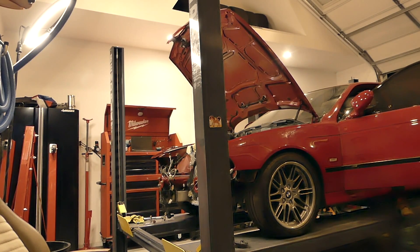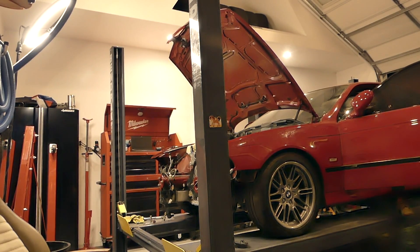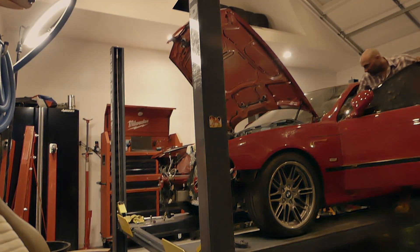Run the engine for 15 minutes, varying your RPM between roughly idle and 5,000 RPM. After 15 minutes, stop the engine and change the oil. Step 5: Change the oil once again using mineral oil, break-in oil. Then drive the car normally for 100 to 200 miles approximately, and then do yourself another oil change.